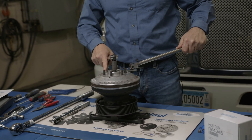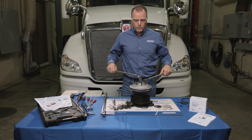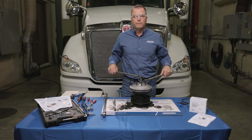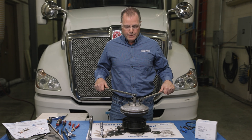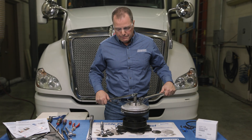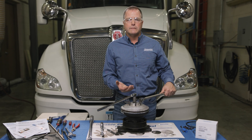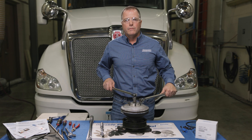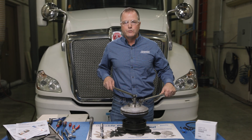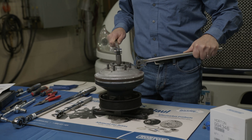To break the jack bolt loose, I always like to do it by hand so you can feel it loosening. If you use an impact, you can sometimes strip out the T55 Torx bit. Note that it says left-hand thread on the fan mounting disk — that's from the back side, so it's a little confusing. It's a right-hand thread, so it's righty-tighty, and you push away from you to break it loose.